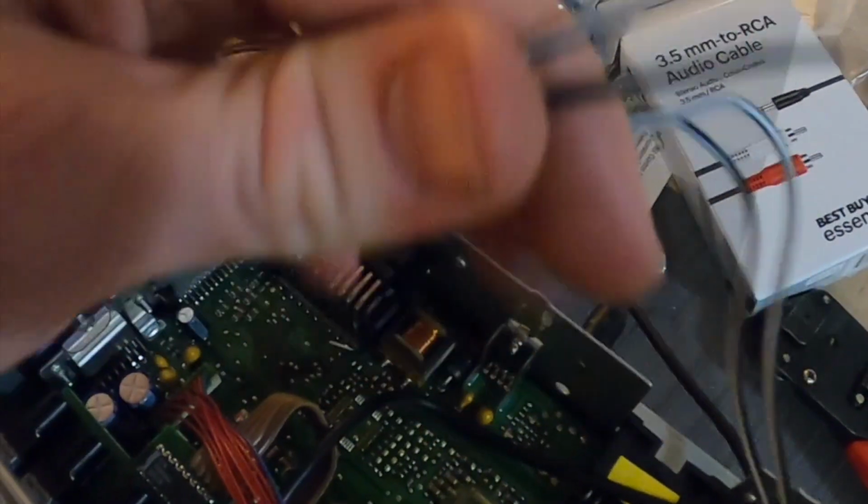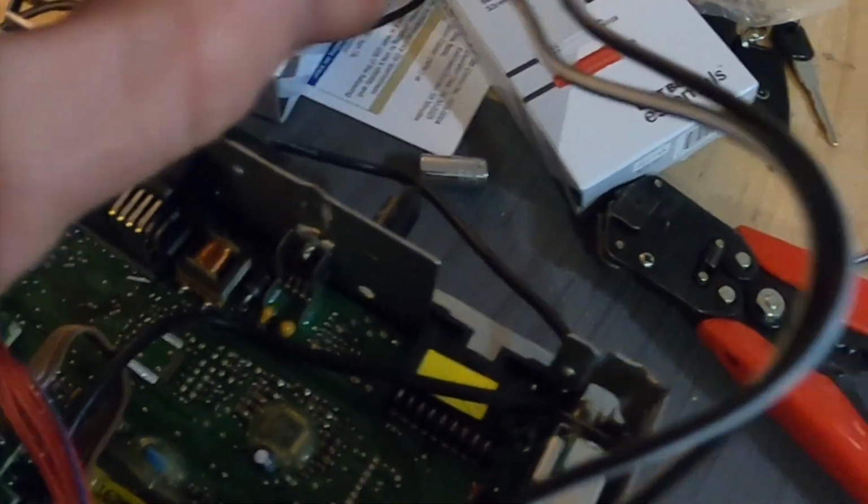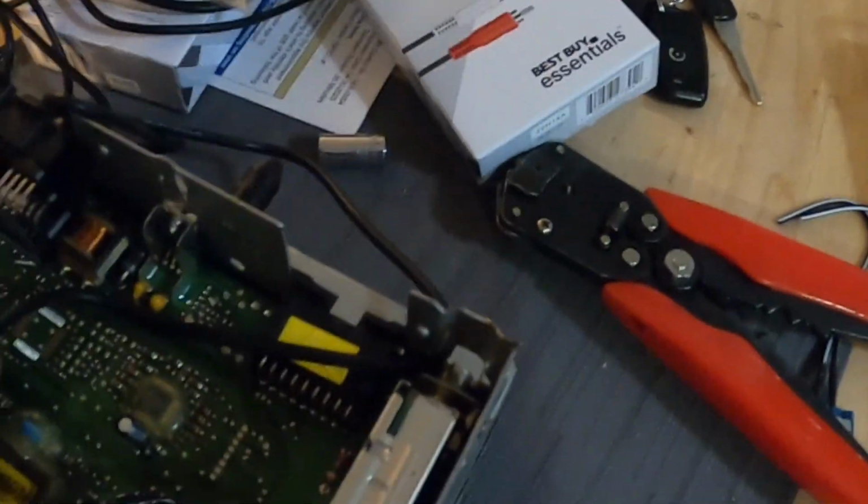And that already got you on where the switch goes and stuff. Seventh wire on the switch. Cut that in half, put one to each side. So I'm gonna tape all this up inside here. Leave a little slack on the inside so we don't yank on it in the radio. Probably wire tie this to here or something. And then we're gonna put it back together, and then we'll slap her in the car and see what she does.